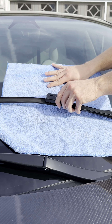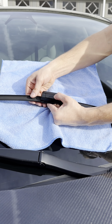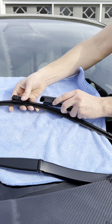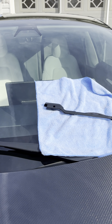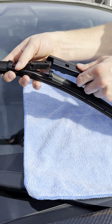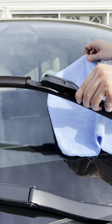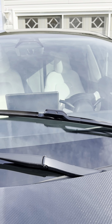I get my microfiber towel under right away for safety, press down that square in the center, and wiggle it out — pretty effortless. This one was fighting me a little bit more but came right out with no real force. We go ahead and install the 19-inch wiper blade using the same tactic — pushing it in and wiggling to victory until it slowly clicks into place. Take your microfiber towel off and you've installed wiper blades all by yourself.